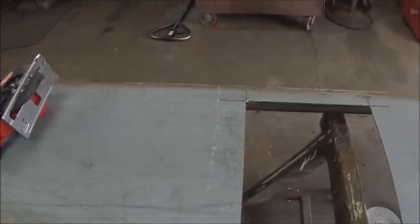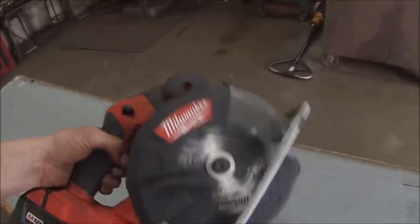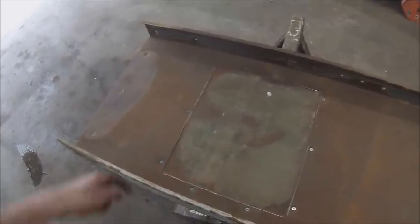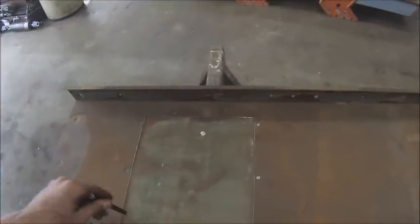The nice thing about that saw is it gives you a nice straight cut, unlike a Sawzall. One thing you've got to be aware of - definitely have your safety glasses on because it throws shavings everywhere, but it's a handy little thing. Got the delete plate all back in. I punched the holes in and they need to have a taper in them for these flathead screws, so I took a piece of round stock and ground a taper on it that matched and just set it on a block of wood so they had something behind it that would give and dimple them. It pulled out way too far, which was what I was kind of afraid of without a backup punch. But I got lucky - I put all the bolts in, got it tight, and then laid a piece of steel underneath it right up next to the bolts and dollied it back out flat. That was a good deal.